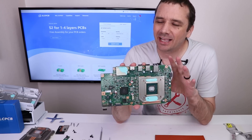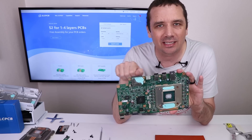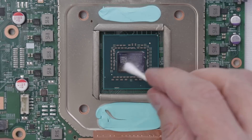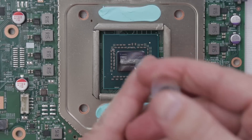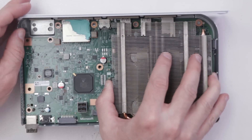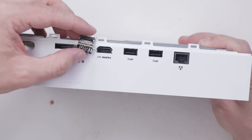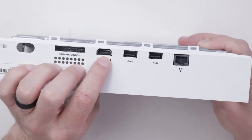So now I have the HDMI port replaced, but as I said earlier, it does not fit in here like the original fit in. So I've got to see if I can fit it into the case in a way that'll make it so the HDMI cord can plug in. The only way I can do that is to put it together enough to test it, then we'll get it started up and see if there are any other problems. Of course, I wouldn't forget to apply the perfect amount of thermal paste. So let's see how this fits in as is and see what we need to modify. The port is kind of pushed way back inside the case — the old port is extra long, so it will stick all the way out to the edge of this case. I'm going to try and plug an HDMI cord into this and see what happens.